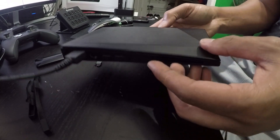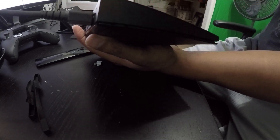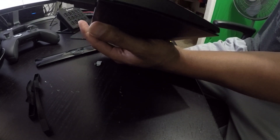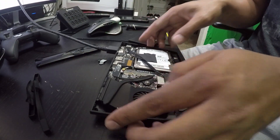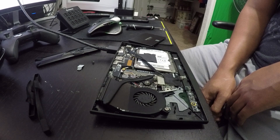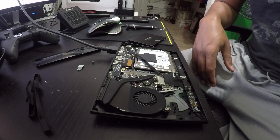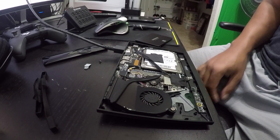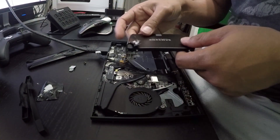For those of you who have never opened an NVIDIA Shield before — whether you're replacing a dead hard drive or swapping to a solid state — it's super simple. All you have to do is take a flat-head screwdriver, put it right in the side of the NVIDIA Shield, and it will pop open right away. After that, all you have to do is remove the screw on top and a few tape strips. Check my other video for a visual walkthrough. It takes about five minutes.